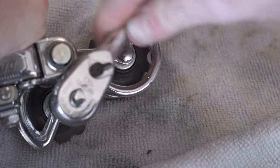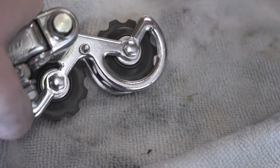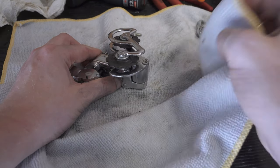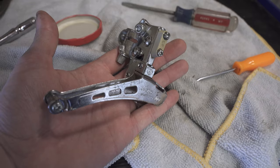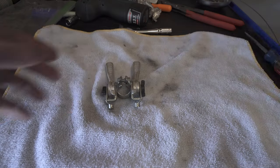One of my pro tips: I actually like to use a short ratchet when working on parts like this because it naturally limits how much torque you can put into the part. I have a torque wrench and you can look up specs, but a lot of these old parts you're not really going to find torque specs for. Just not going crazy is always a good call.